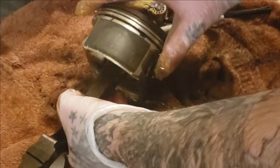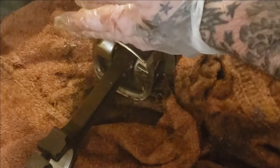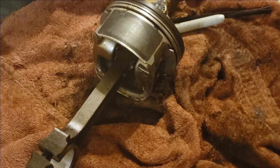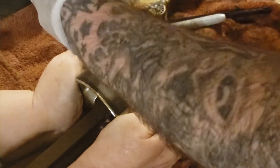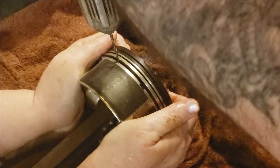Now that we got that, you can lock this into a vise, or two boards or something to hold it steady. If you're using a drill press, use a soft vise or something and clamp it down — just make sure you don't hit the edges here. But I'm using a hand drill and I'm doing it on the kitchen table, because it's cold outside. Get somebody to hold your piston or clamp it down. Take your time when drilling and make sure you get centered.